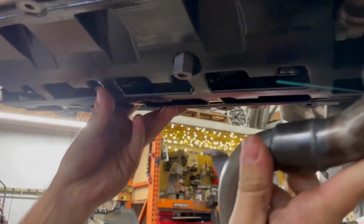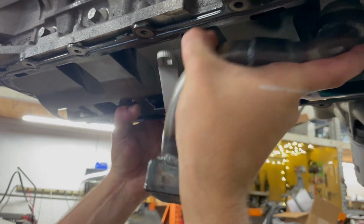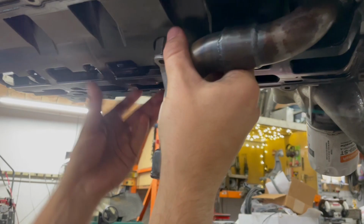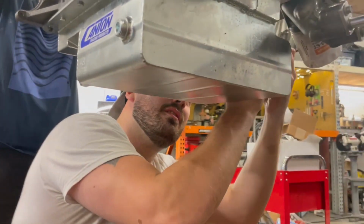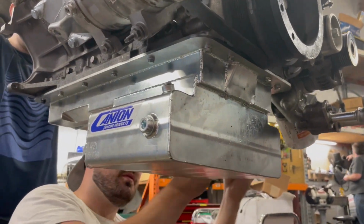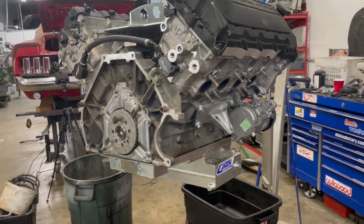All right. So this little hole right here is custom drilled by Devin French. And the reason is that the new pickup bolts to the little standoff right there. And that's how that do. These expensive engines and their silly torque specs: 89 pound-inch, and then 45 degrees. Historically, every single oil pan that I've ever put on, I've just good enoughed it, but yeah, you want to do things right in these situations. Okay, oil pickup pan situation sorted.